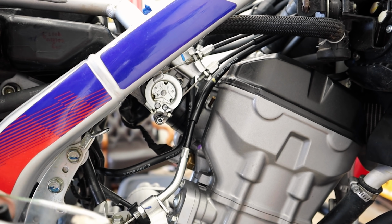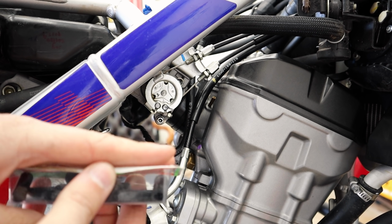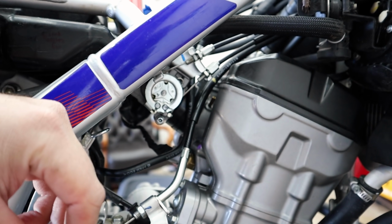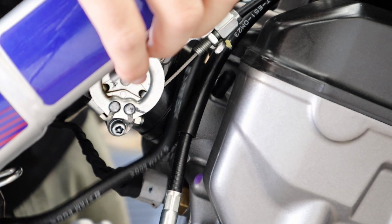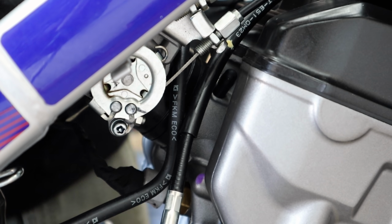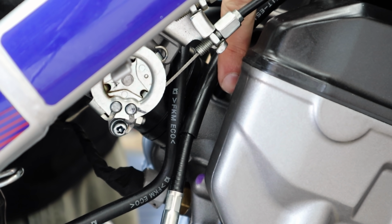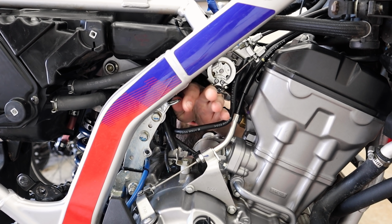Now we need to plug off our little vacuum nipple thing right here. Simplest thing I think to do is just go get you a set of these sort of generic little vacuum nipple caps like that. I'm gonna go with the skinniest of them. That's super tight on there. Down on there, that's gonna be good to go just like that. You could try to get a little clamp on there if you want, but it's not gonna need one. That is definitely tight. And when we want to add nitrous, we can add it right there. And with that, our canister is deleted.